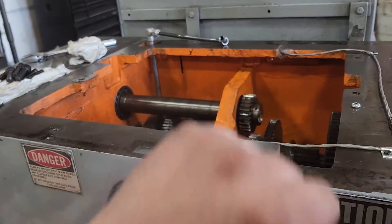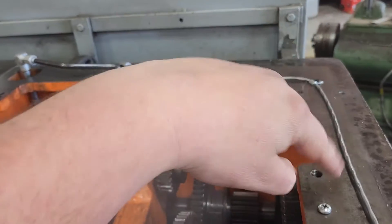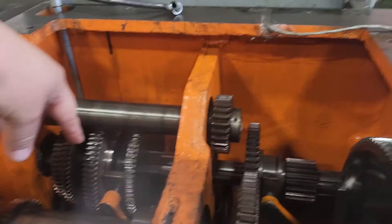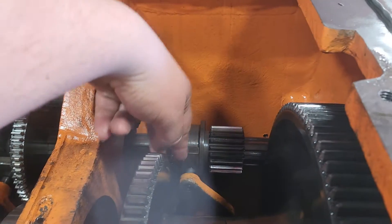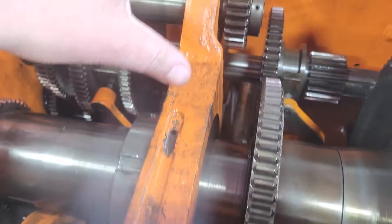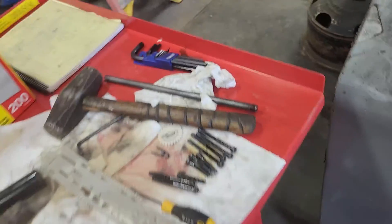I removed it. It's going to be four main bolts here and this whole thing will lift off. You've got to undo this hydraulic line — very easy. You've got a fork that sits right in the middle of here, and a fork that sits right in the middle of here. And then you'll have a steel rod that runs right here and goes to the shift unit. You can pull that off — that rod will just come off.